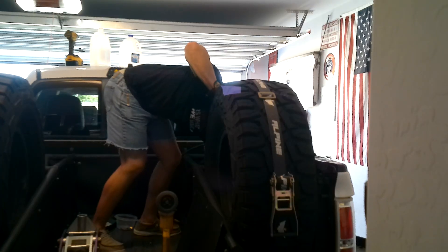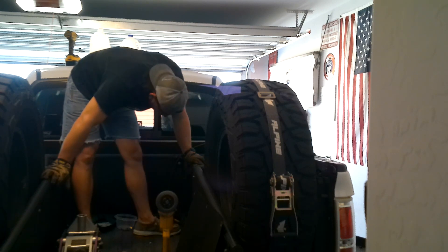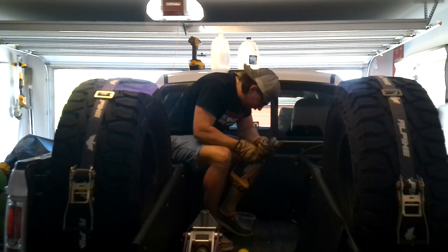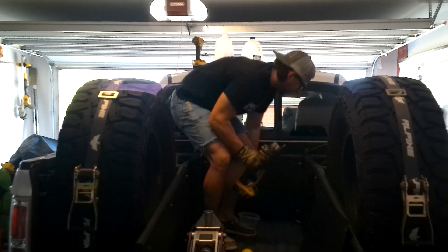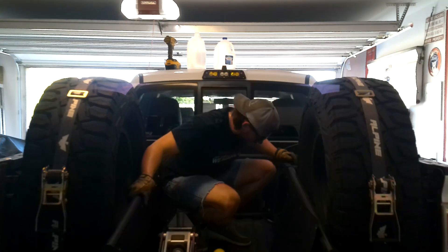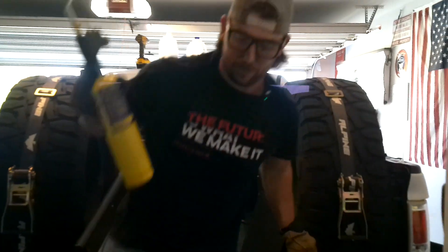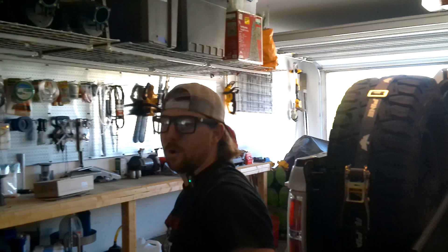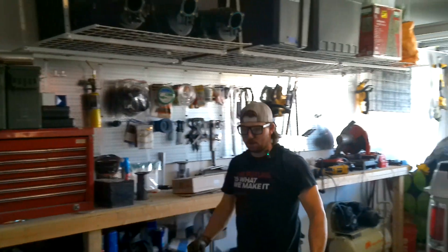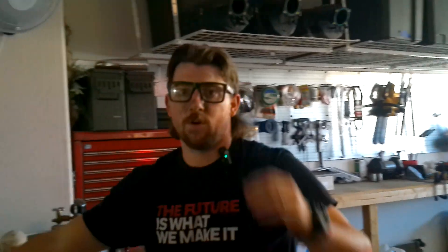Let's grind this guy down a little bit. The important part of that isn't going anywhere — I don't even think that's worth trying to clean up especially since it's just gonna get cut off in the future. I feel better about off-roading with that now. Get a better welder — more hotter is more better. By more hotter I mean something hotter than a 110 hobby welder, especially when you're trying to weld through 120-wall and quarter-inch steel. I am under-equipped.